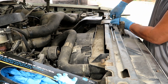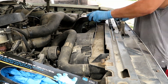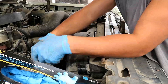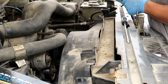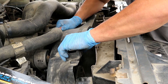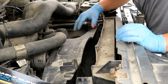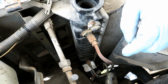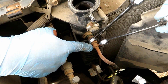10mm for the overflow hose, 8mm for the hose. The bolt that holds down the fan shroud is 10mm. We can go ahead and move it forward — we're going to leave it in place because if not we have to take off the fan. Take off this overflow hose. The big nut is 5/8" and the B nut is half inch.